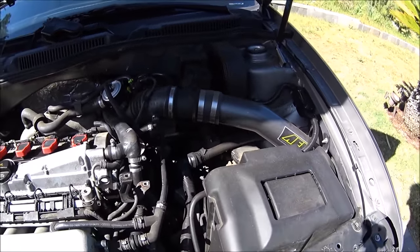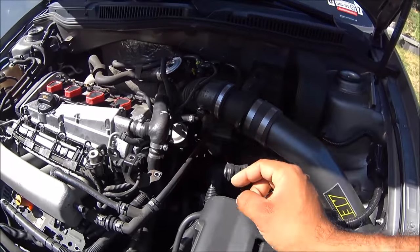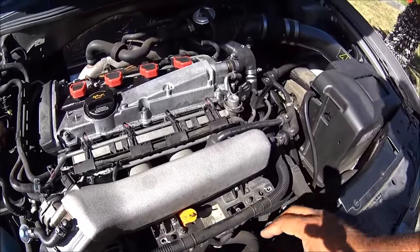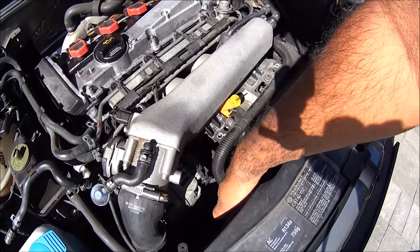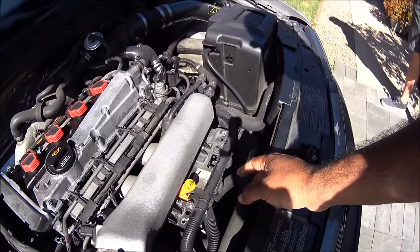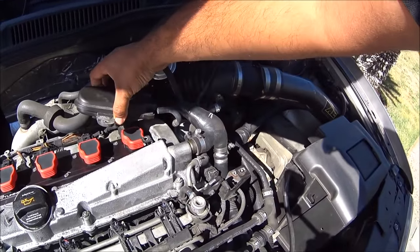You're going to need a couple hand tools. You're going to need some dykes or wire cutters. You're going to need some Allen wrenches to remove the combi valve, a 10mm to remove the plastic secondary air pipes, more Allen wrenches for here, and a 13mm to take out the secondary air injection pump itself. You guys are also going to need vacuum caps because we're going to be removing a lot of vacuum hoses.